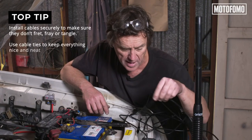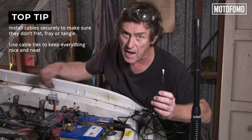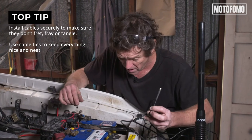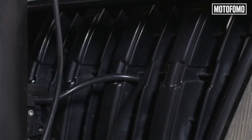The antenna cable needs to be fed from the antenna through to the cabin. It's always a good idea to follow a wiring harness if you can, as wiring harnesses snake their way all around the engine bay. I don't actually have a wiring harness to chase, so I'm going to follow the air conditioning lines.